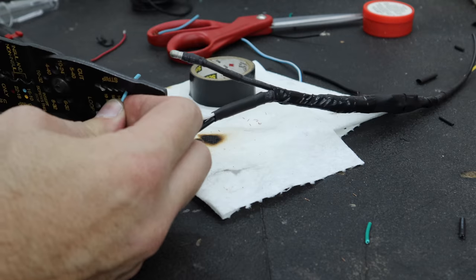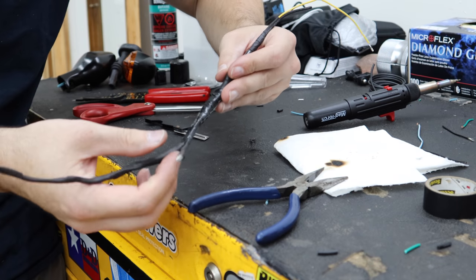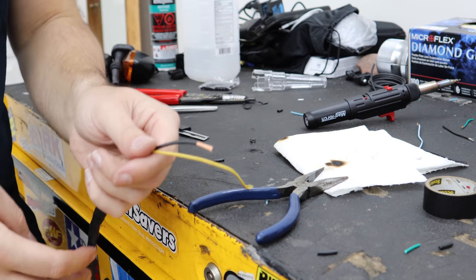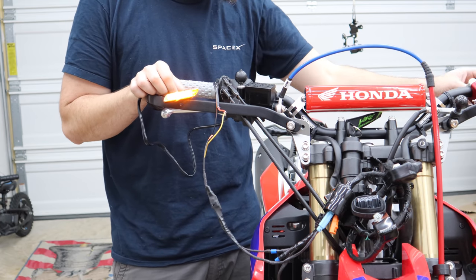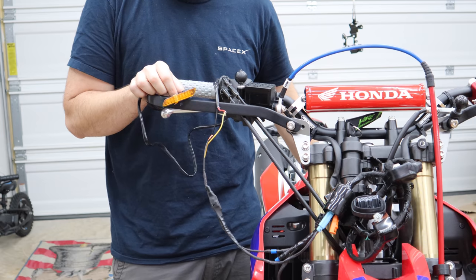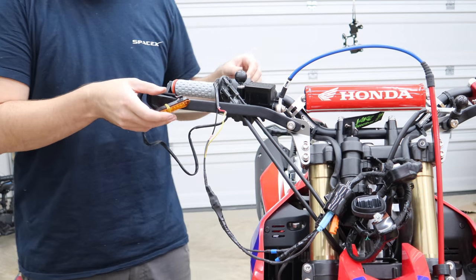According to the chart we made, the green wire coming off of here needs to go to the black wire — both black wires in fact. Then we just put our blue and our white together. Through the power of heat shrink, we've got this. Plug into the normal turn signal stock connector, plug in our little extra cable, and this should go to the turn signal and work. Let's do a quick test — turn the key on. There we go, we get our little yellow light. Now let's go for the turn signal. Look at that — it works!